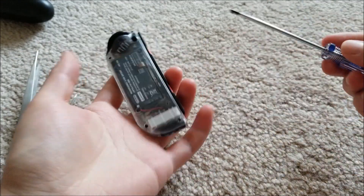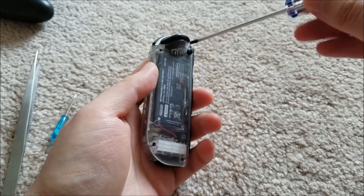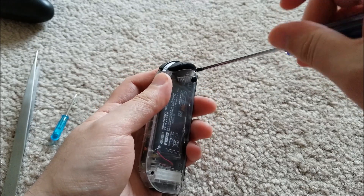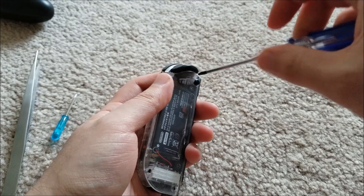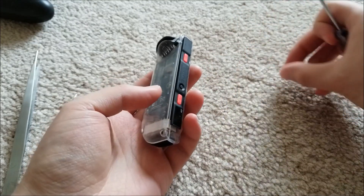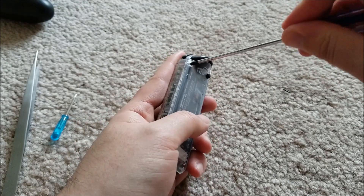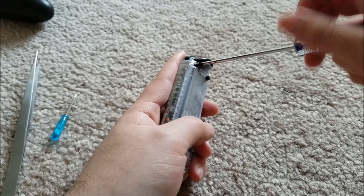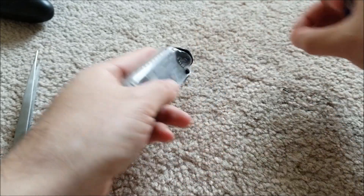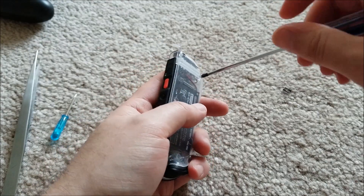So you're going to need a tri-wing screwdriver and there are just four screws. Just ignore the fact that these are clear Joy-Cons — you can do this on a stock unmodded Joy-Con as well. If you're not entirely sure about taking apart your current Joy-Cons and you might damage the flex cable that the LEDs are mounted on, you can actually buy replacement ones and do the mod on those.